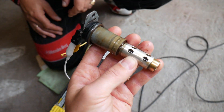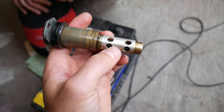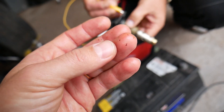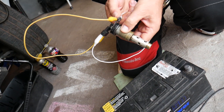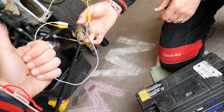It's testing perfectly. Now you may still get an engine light and a code — why? Because if your Vanos solenoid is dirty on the inside, you may have something preventing it from opening and closing all the way. You will need to clean it, and you can see some dirty residue coming out of it. We'll have a video on the channel that explains how to clean it — I'll put the link in the description below. Thanks for watching, see you guys next time.